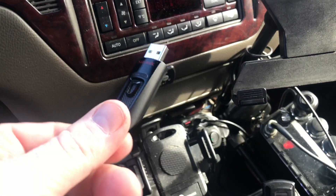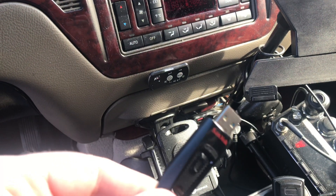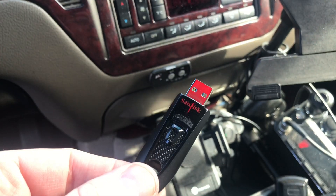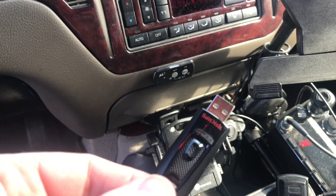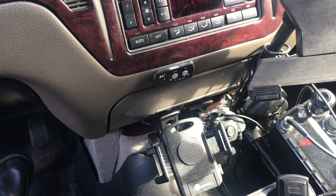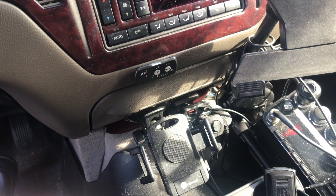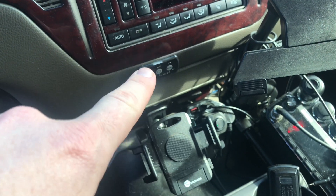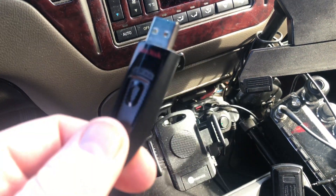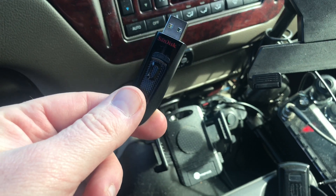I'm going to update my firmware now — I have the new firmware on here for the unit. What I like to do is just keep the firmware on the device, update the firmware, then I'll go back in the house and install the configuration file. That way nothing goes wrong on the install. Now, if you do have the Hi-Fi unit with the external speaker, the good news is that that file is actually stored on the little module itself, not in the brain like the firmware is. Now I'm just going to plug this into my upgrade cable for the ALP and then power it on and get the update going.